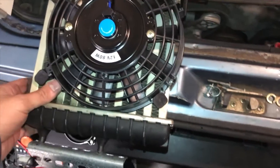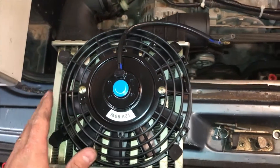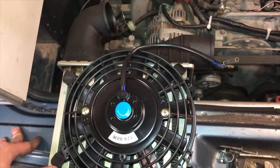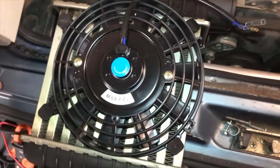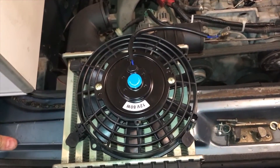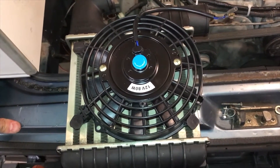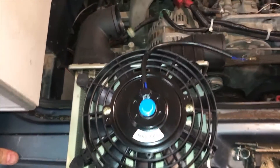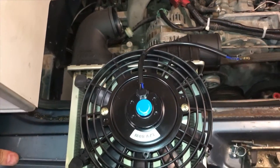This is what I plan to do with my intercooler — you kind of have to leave it up to your own ingenuity. It seems like everybody runs different intercoolers. I wanted to run an air-to-air intercooler because I didn't want to deal with another possible coolant leak and running new lines all the way up to the front. I feel like I've already got enough clutter on the bottom side of my van.